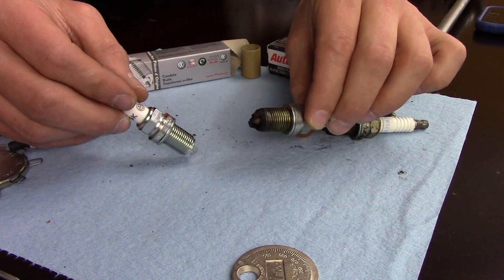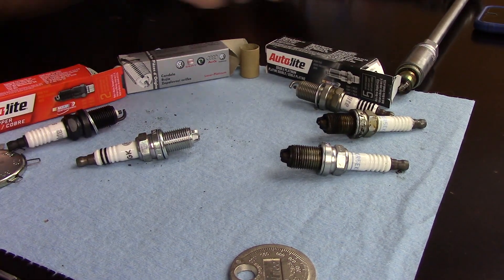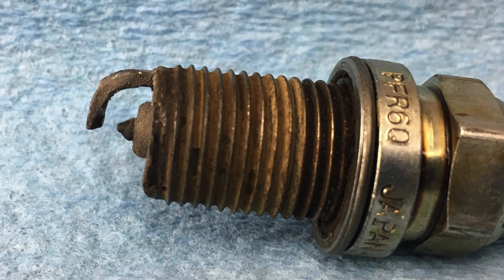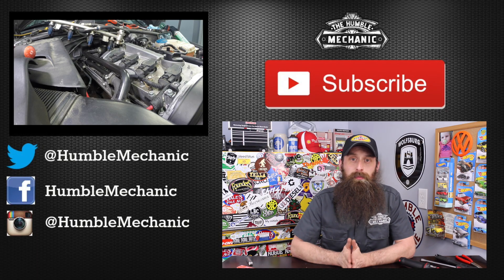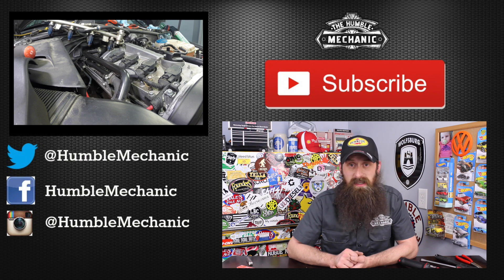This one came out of the Cabbie — nothing really too much to worry about. What you want to be looking for is more buildup like this, where you've got deposits and maybe a little bit of uneven wear on the ground electrode side. So there you have it. I hope you learned a little bit more about spark plugs, or maybe this was a bit of a refresher course. I'm going to go ahead and wrap it up there. If you guys have any questions or comments, please post in the comment section below. If you like the video, throw it a thumbs up on YouTube. You can also subscribe on YouTube or on the blog at HumbleMechanic.com, and follow me on Facebook, Twitter, Instagram, and the blog.